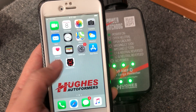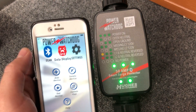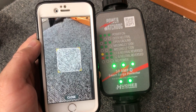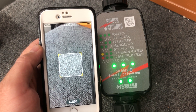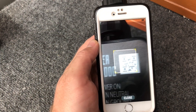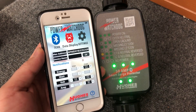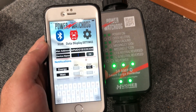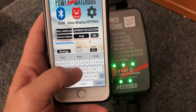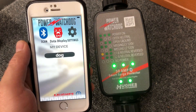Download the app, open it, and the first thing you're going to do is click Settings, then click Add Device. It's going to ask you to access your camera, so you need to give it permission. Use the scanning box to scan the QR code, and once you scan it, it should pull up the device's information. You do need to give the device a name — it can be anything you like, but it has to have some name associated with it. Once you put that name in, go ahead and click OK.